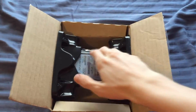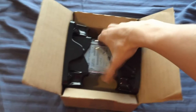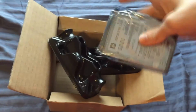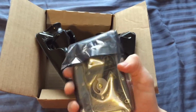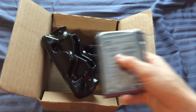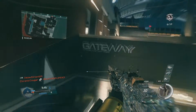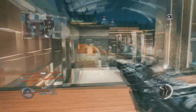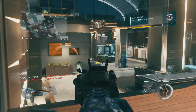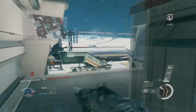First of all, you need to buy a new hard drive. That's a bit obvious. I bought a 1 terabyte hard drive. I recommend you buy at least 1 terabyte. The hard drive must be 2.5 inches. I will put a link in the description of all the other requirements if you're curious, but just know 2.5 inches is what you need. Most commercial 2.5 inch hard drives will be perfect.